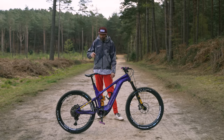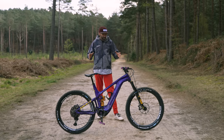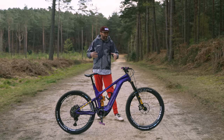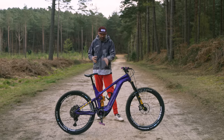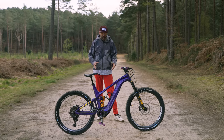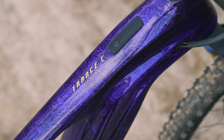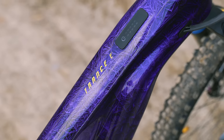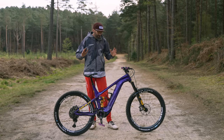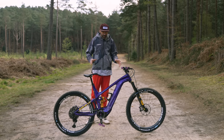So this is going to be perfect for my everyday mountain biking around my house. 150 fork, 140-mil back end. I did a Reign e-bike check a couple of weeks ago. I have been riding it now and can tell you a bit more about it. The 85-newton-meter motor — the heart of the bike — is incredible. The sync drive motor, no display. You don't need one. You turn it on and off there. It gives you your power output on the top. There are a couple of buttons to change the power up and down. I love the minimalistic nature of the setup.